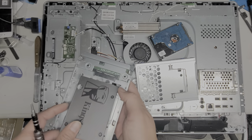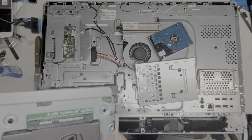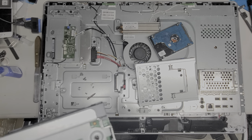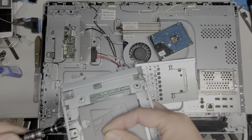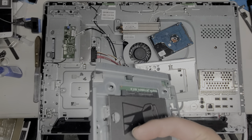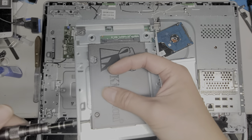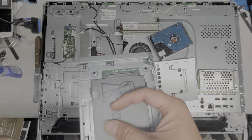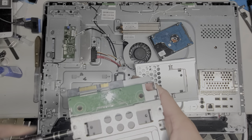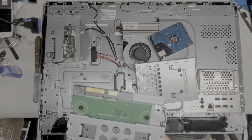To remove the hard drive, just slide it down like that. Grab the SSD, plop it in, and slide it up that way. Then get the screws and put them back. Everything now we just do in reverse — there's no special tricks. The one thing I'll show is putting the cover back, because you do have to swing it back a certain way. It's basically the reverse of how we lifted the bottom up first.